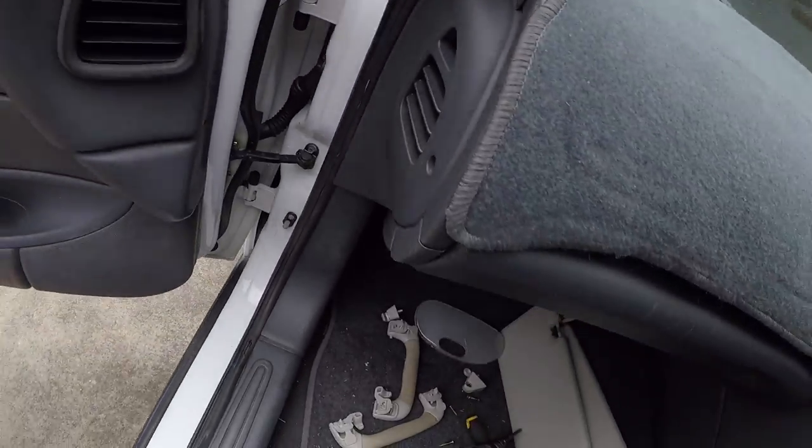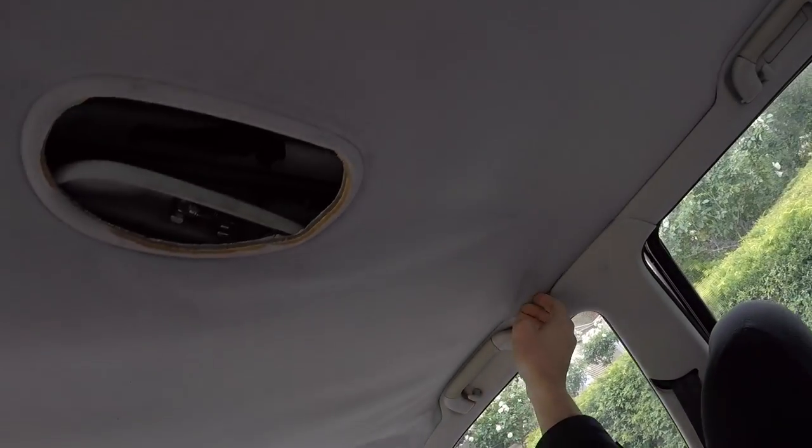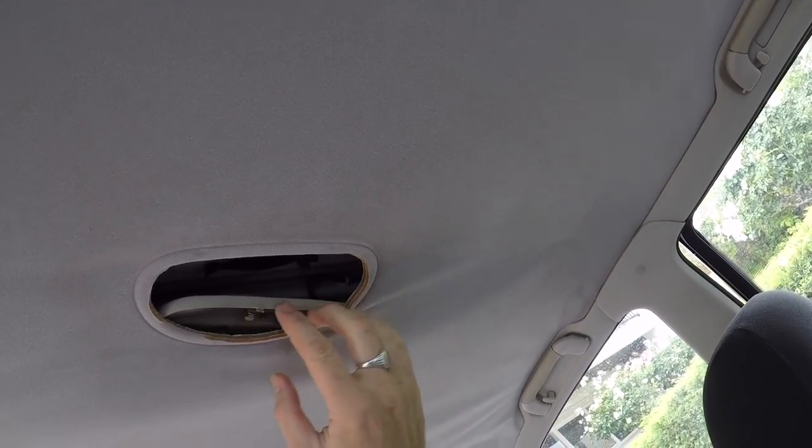Today's job is going to be the same across all the Commodore range from the VT, VX, VY, and VZs — they're all pretty much the same method of removal and reinstall. I've started off by taking off the grab handles themselves to remove the A pillar, and then I flex the B pillar away from just the top, as there's a single screw that holds it. The dome light in the middle will just pop off the lens cap, and then you gain access to two screws behind that lens cap to drop down the dome light.